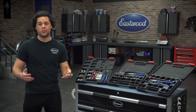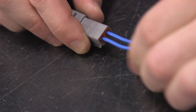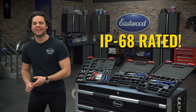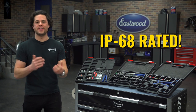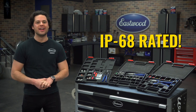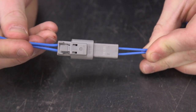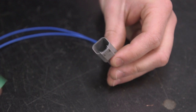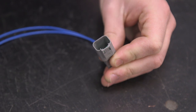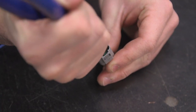That means you don't have to crimp one on yourself — you just slide the pins through and you're all set. You can see those seals on either end, and you have your grommet at the disconnect in the middle. These are IP68 rated, meaning they can handle three feet of water for half an hour, so you know these can handle whatever weather your project car is going to go through. These also lock the pins in place with a very sturdy, reliable internal wedge lock system, so assuming you can get a good crimp going — which is super easy with the crimping tool that comes included — the wires aren't going to back out.